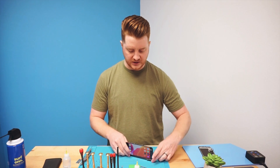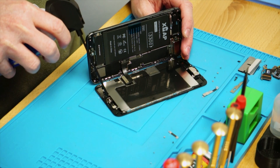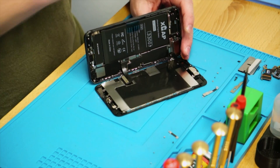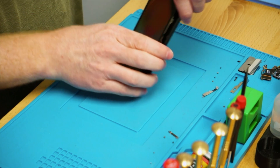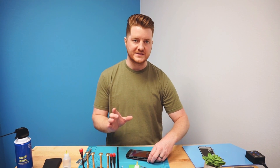To accelerate this, go ahead and take a little bit of canned air and give a light blow on the home button itself on the back side. This should clear out the sensor enough that it will start to function again. So now if we take this one and try that again, we can see that it does restore the return to home function once again.